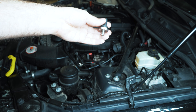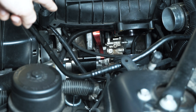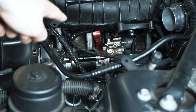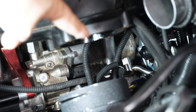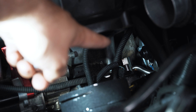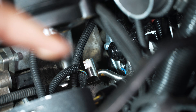I put out a video talking about that and showing you how to monitor the pressure. I was investigating a fuel smell or a fuel leak under the hood. I already have the Helix Overdrive four times kit attached to my HPFP to investigate. I already removed the throttle body and I noticed that there was fuel leaking right from where the low pressure sensor sits.